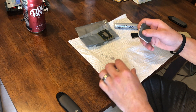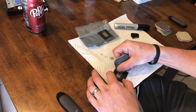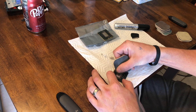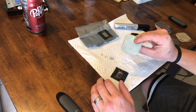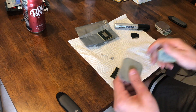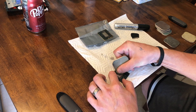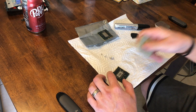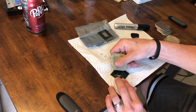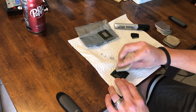At this time, we're going to fine sand and polish the die. Once we complete this step, it'll be ready for final cleanup and install. While this can be done using normal sandpaper at 600 grit or greater, I prefer to use micro mesh pads. I start with 1200 grit and then follow up with 2400 and 3200 to really polish it up nice. If you don't want to buy a set of pads, some 600 grit sandpaper followed up with some steel wool will do just fine.